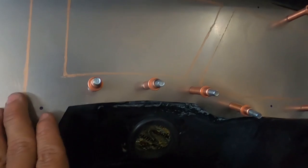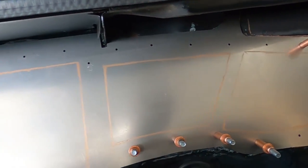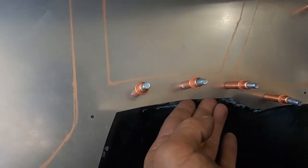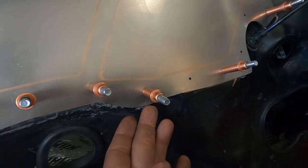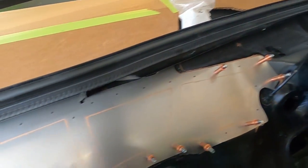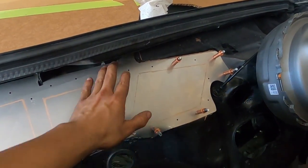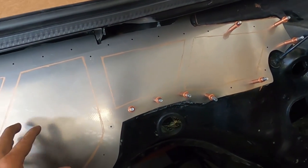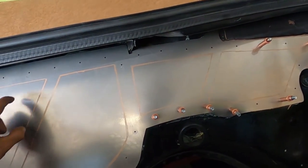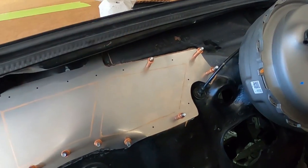Eleven minutes later — it's definitely a bit of a challenge to get the panel squared up, but man, it's going to look amazing. Yours will have the bead roll with some nice graphics to make it look real sharp. Now you can tack weld all the way around, do body work, and finish it however you want. We'll take this back off, do the bead rolling, and then come back and put more clecos in and tack weld it.